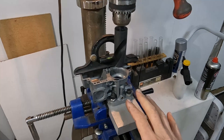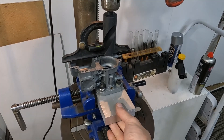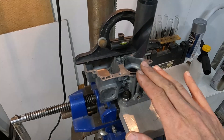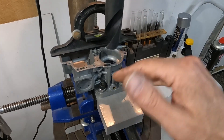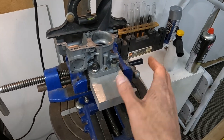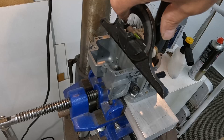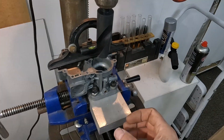Here's the setup to make the cut. As you may have noticed, I put this on an aluminum base and clamped it like this because that allows me to clamp the piece better. I've centered the piece and also centered it with the ball so that everything checks out fine. Those are the things you need to be careful of when doing this sort of thing - that you make a straight cut on a kind of XY basis.